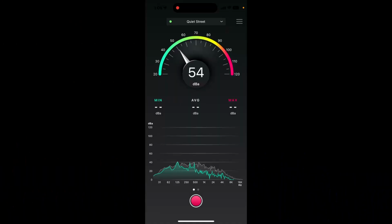All right, so I've got the compressor completely installed. I took out that horse stall matting and I put it on just the silicone little rubber mounts, and it's pretty quiet now. I had the old original compressor, which is pretty loud. This one's a lot quieter. It's probably about as loud as the one they put in the iCube update, but that one isn't as fast as this one. This one's a higher CFM, so I think it's worth doing it because now it's a lot quieter and it's quicker. So what I'm going to do is just show on the stopwatch the recovery time.